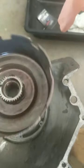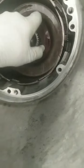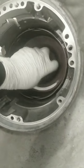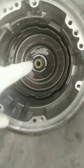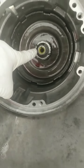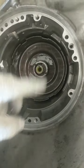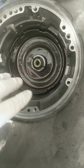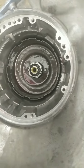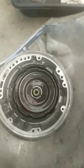This is the sun gear. It's all been checked out — it's not really worn out, it's a pretty good unit still. I just pressed new bushings in it, cleaned it up, it's going back in. I use a plastic bushing here because the metal one they usually scar the shaft and part of the bushing actually seizes onto the shaft. I've taken the plastic ones out of 200,000-mile transmissions with no problems and it still looks good. Everywhere else I'll get rid of the plastic and put a brass or metal bushing.